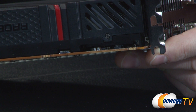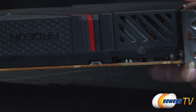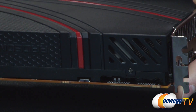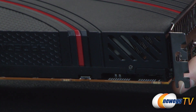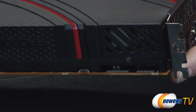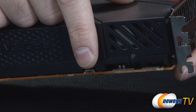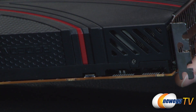One little element I want to point out is right down here - a tiny little switch which you might be able to see right there. Basically, that sets up a couple of different fan profiles. One of the first things you're going to notice about this card, or at least if you look at my benchmarks, is temperature. This card is actually designed to run at 95 degrees Celsius, and it does run at 95 degrees Celsius pretty much all the time when it's under load. That is by design, so don't freak out if your card runs hot - that's what it's supposed to do. We've confirmed this with AMD a couple of times already. In fact, I hit 94 in pretty much every single test I ran. This switch is basically going to set up a couple different VBIOSes, adjusting the fan profile from a 40% cap on fan speed to a higher cap.